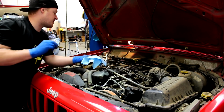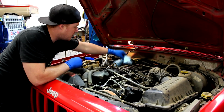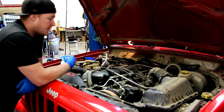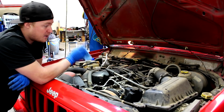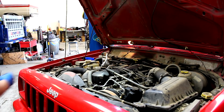It's high, so that's kind of surprising because this thing leaks a lot, and I haven't topped it off at all since the last oil change. But it's still at the top full mark. So here, actually, I'll leave it like that, so I remember to make sure this thing gets all filled up. And then I'll check the transmission fluid level as well. So I'm going to go ahead and start the vehicle and just let it run in park, and we can check the level that way.